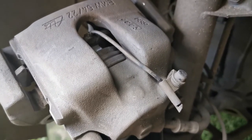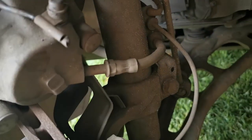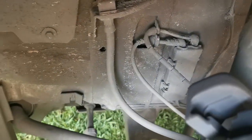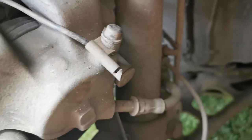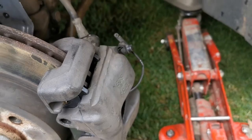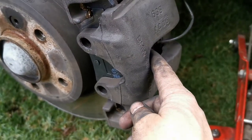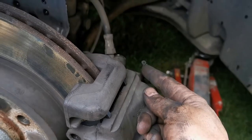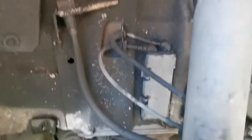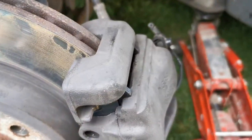Interestingly, the side where my brake wear sensor is has been cut — the sensor hasn't been working for a long time. I'm not sure how the dashboard light was off the whole time and then suddenly came on showing the brakes were finished. Since the sensor is cut, I'm going to have to buy a new sensor. Even though the old sensor might still look okay, there's no point keeping it. I'll check if it's been breached somewhere and eventually put a new one in.